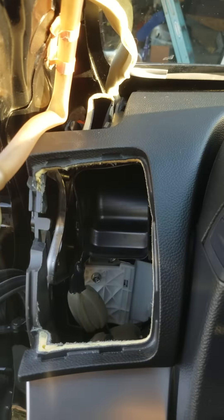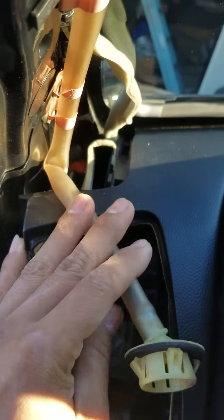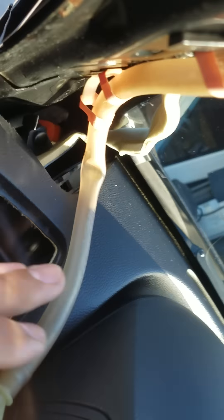That's why you have the floor mat and everything start leaking. I'm gonna show you how to fix it. As you can see, I put a screwdriver in where the hole is at — let me zoom in for you — and you can see where the drain hole goes into the firewall. You see where the orange thing is with the screwdriver? That's where it's draining, but it's not draining properly because of this.